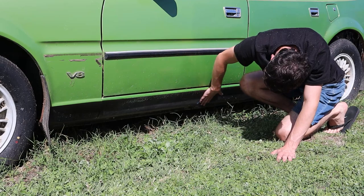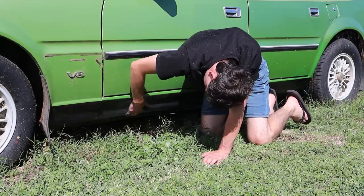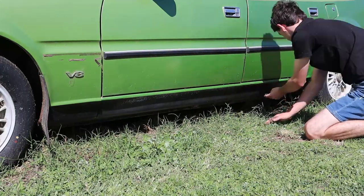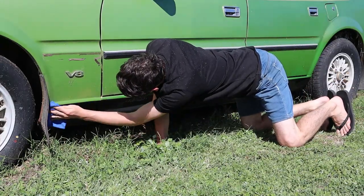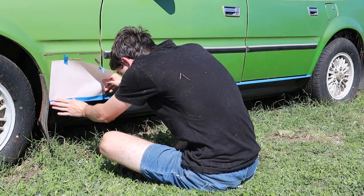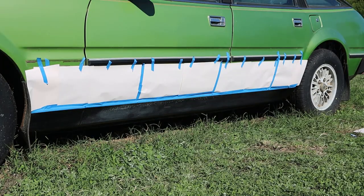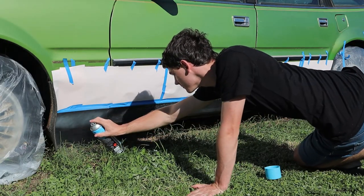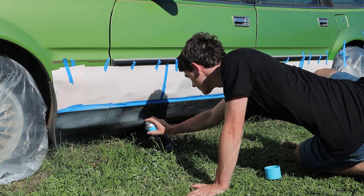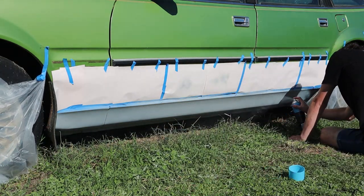Since I spray painted part of the black on the tyre, the rest of the black trim looked horrible. So I sanded it down with 80 grit sandpaper, gave it a wipe down with rubbing alcohol to remove all the dust, then taped and blocked up the green so no overspray got on there. Then I did the same as before, applying three coats of filler primer, then three coats of the gloss black. I didn't put a clear over the top because it was already gloss.